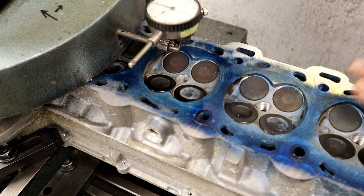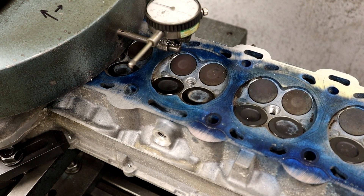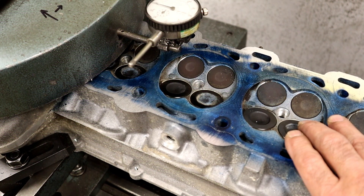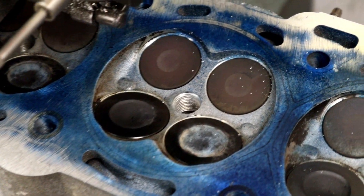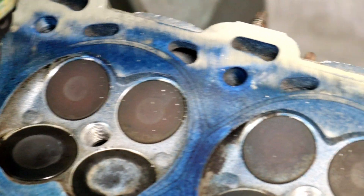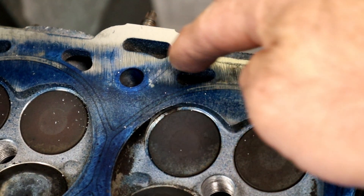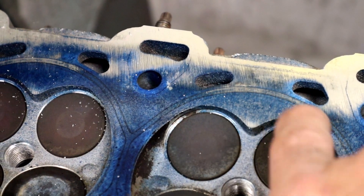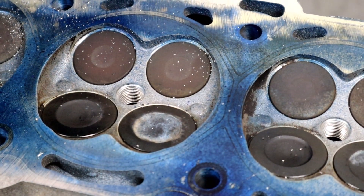So what happened? He sanded all the way around — really nice. You wonder why it's leaking, why it has combustion gases in the radiator? If we zoom in nice and close, look at all that. How is it going to seal combustion gases? It's torquing down out here, getting a nice clamping force out there. What clamping force is it doing here at the seating ring? And you wonder why combustion gases are getting into the radiator.